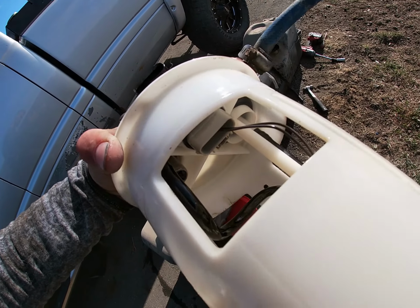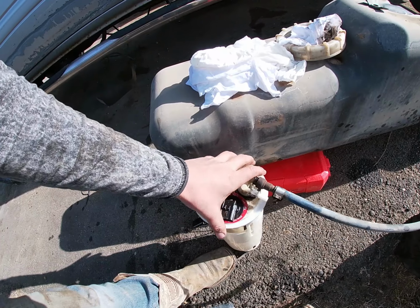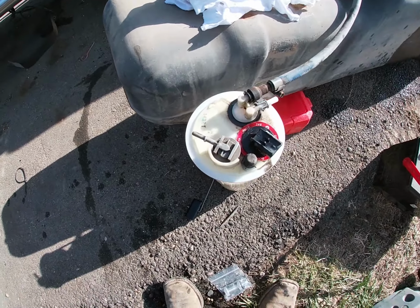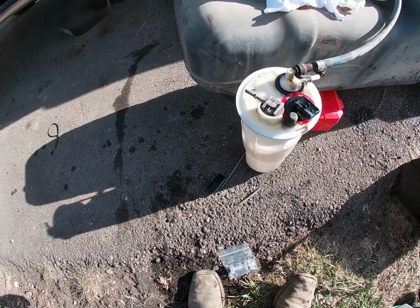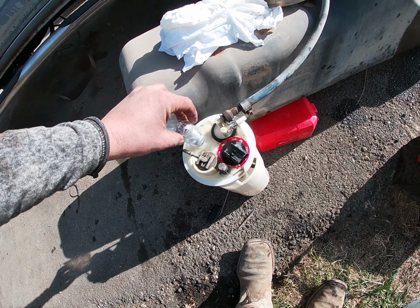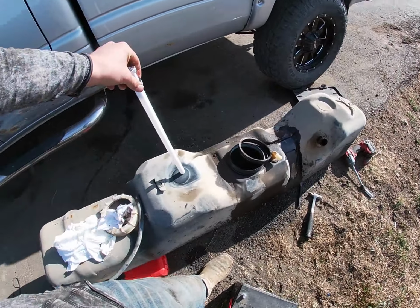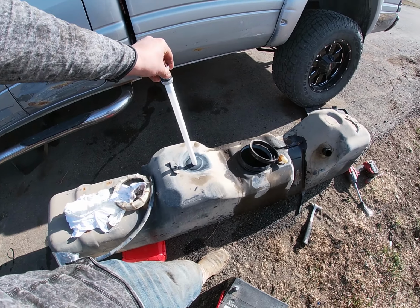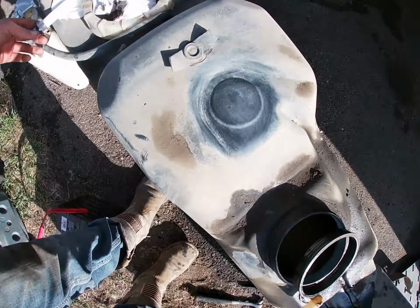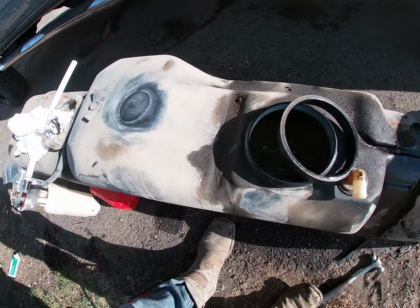So, if you can see inside there, it's got the four dividers, and then it's only got one spot where we can put one other thing. What they show, I guess this kit was a little complicated when I was ordering it. It shows the newer style fuel pump, but I'm gonna make this one work. I'm gonna just put one of these right here. I think I'm gonna do the return in this. So this one will be the return, and I already put together this tube for the suction, and then I think I'm gonna put it right here, just because that seems like the flattest surface for it to seal, because as you can tell, pretty much nowhere else around this is flat enough to put it in. So I think right here it is for now.